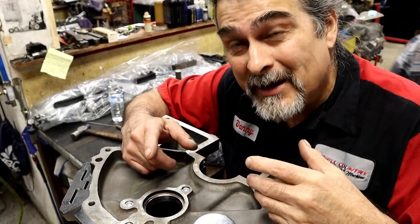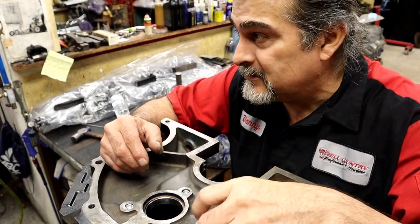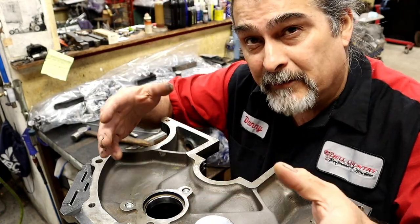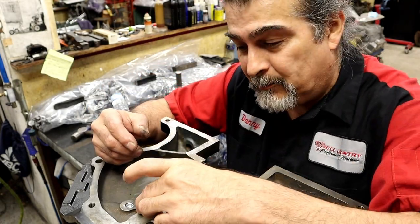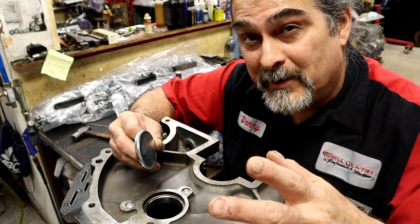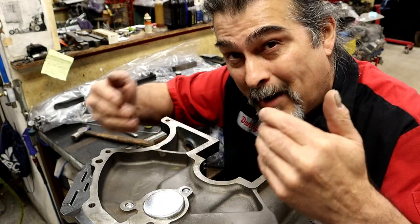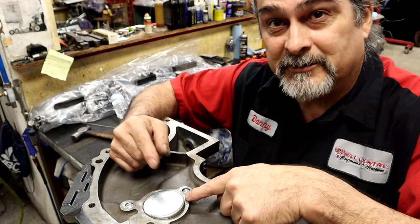Since we're here giving you tips of the day, I'm going to give you the biggest tip of the day on Ford FEs: this freeze plug right here goes in backwards. It doesn't go in this way or it'll rub against the cam. A lot of engines have come in after being built just because of that — you get annoyed, you don't know where the problem is, it's burning up, all blue back in there. So the rear freeze plug goes in backwards. Tip of the day: put the rear cam plug in backwards on a Ford FE.